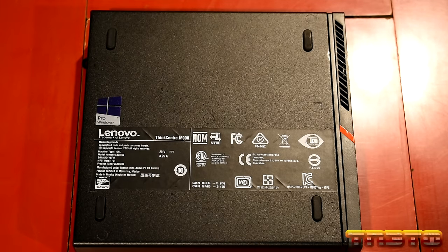You do have the various holes where you can add the standoff. If you guys look, if I switch it around, you guys can see right there. This right here will allow you to basically attach the M.2 drive. So this right here acts as the screw, and you can pop this out and change it. See right there? So it'll allow you to change. So there's two configurations, either halfway or full way. So whatever those dimensions are, those are the two it supports. But the drive I'm going to be putting into it is a 970 EVO Plus, so it will fit. There's a better view of the RAM.